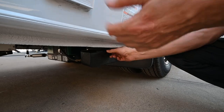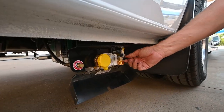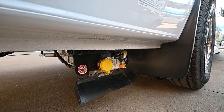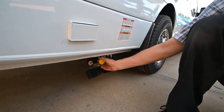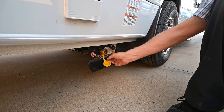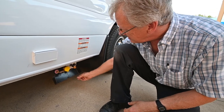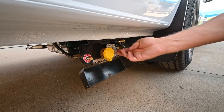When you want to run the propane appliances, there are several things on the coach that run off propane — we've got the generator, the water heater, and others. There's a toggle switch on the right; when you turn that on, you'll hear a nice click underneath the coach, allowing propane to all the appliances. When this tank gets low and you need propane, pull into a filling station that offers propane and they'll fill it here and vent it here. Propane has an odor to let you know if you have a leak.